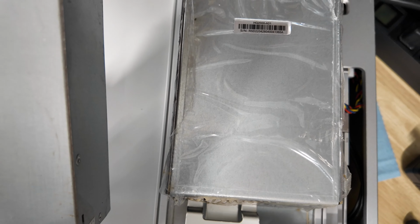So there are no power cables running between these. These are bus bars. These bus bars transmit the power. So the power is being basically generated here in the power supply from your outlet, and then it's traveling on these bus bars into the actual mining device. You will see some power fan connections, and you see these cables. These black and yellow cables are PCIe cables, which are like power cables and things like that. But all of the power is being transmitted here to everything else in the device through these bus bars with this power supply.